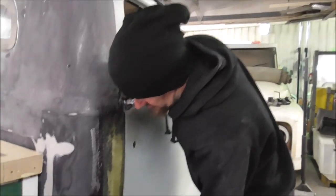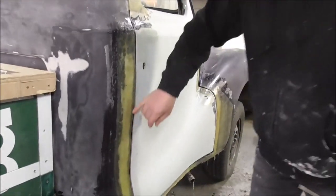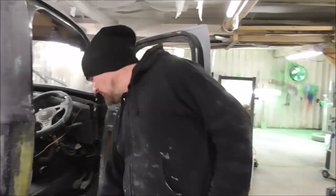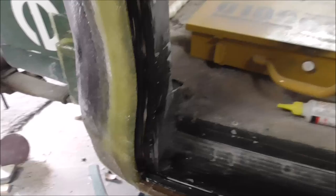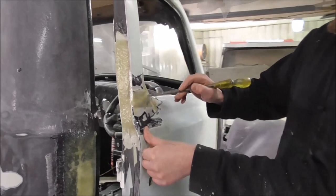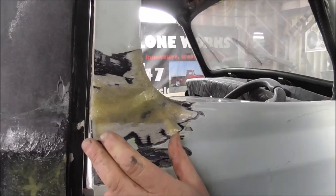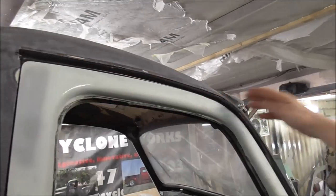It was really bad, and of course we had this massive gap, but what I've done is raised this up with some mat and resin. The door's only a bit out now — it's on its latch there. I've brought this out quite a long way, at least about 10mm down in this lower part. There's a consequence of that — I've also had to bring out the bottom of the sill quite a way, probably 11 or 12mm. I cut the door across here — you can probably still see it behind the glass. I raised this whole section up 10mm and that closed this gap here quite a bit. It still tapers a little bit but we can sort that out.